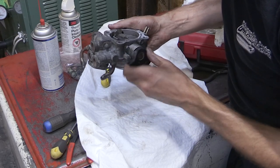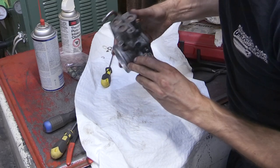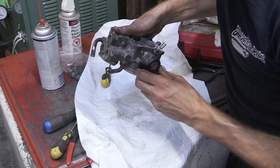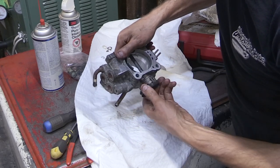And then you should be able to find the right location. There are stoppers on that spring. So you want that spring to be loaded and to have pressure on it when it is closed, because the default setting is to have your throttle body plate closed.